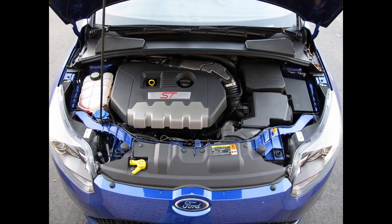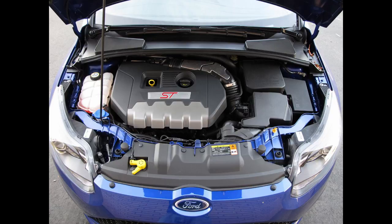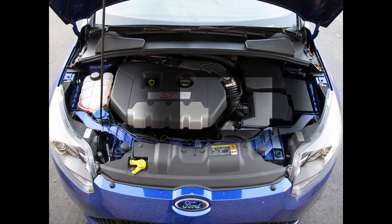First off, what we're going to need to do is remove the air intake box. To do that, there's going to be a strap located towards the front of the car — just lift that up. Once you get that done, you're going to need to remove the air box itself. What you're going to need to do is remove the air box lid to loosen up the filter, and also loosen up the accordion-style inlet hose and remove that from the intake as well.